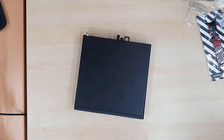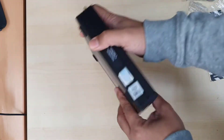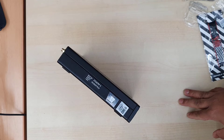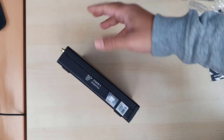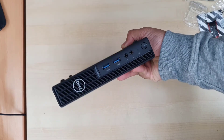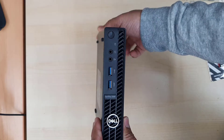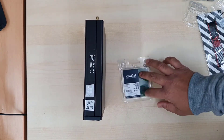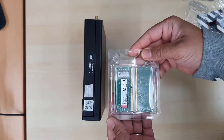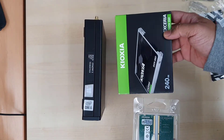Today, to get the best performance, we're going to upgrade the RAM plus add additional storage. For this machine, DDR4 16GB would be absolutely fine because it does have dual slots for the RAM stick, which is DDR4. It also has a secondary storage slot which is 2.5-inch SATA.